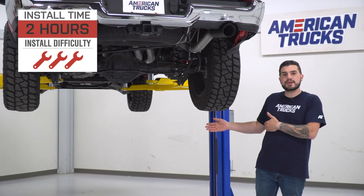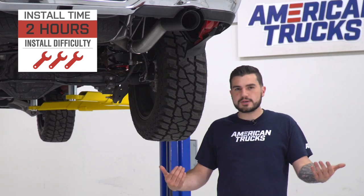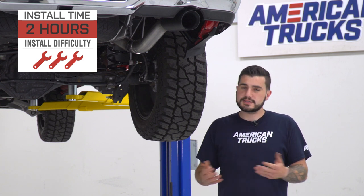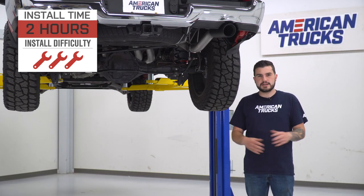Our truck here is a crew cab with the short box, in which case we had to cut 9 inches off of one of the pipes. Because of that, you have to get a table saw or a sawzall or something similar like that, so it does beef up the difficulty just a little bit. In some cases, you may not need to cut at all, and the install gets a lot easier. Now, the install will take you about 2 hours from start to finish. I'm going to walk you through the entire process.